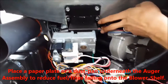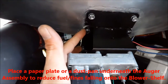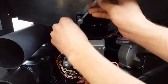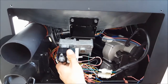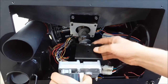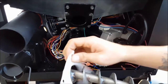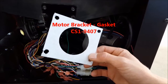Next, we're going to locate the two hex nuts on the right-hand side and the two hex nuts on the left-hand side. Go ahead and take all four of those off. Once you get that last one out, go ahead and slide your auger out carefully so you don't rip the gasket. You should see a pretty good gasket going all the way around performing an actual seal.